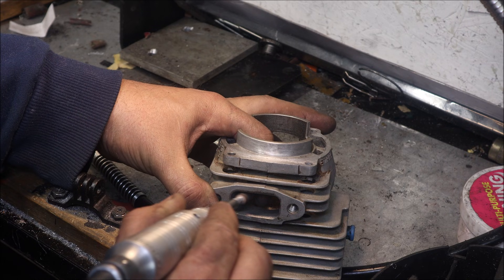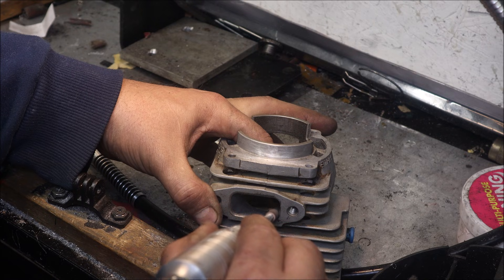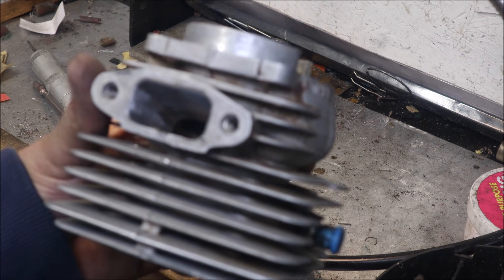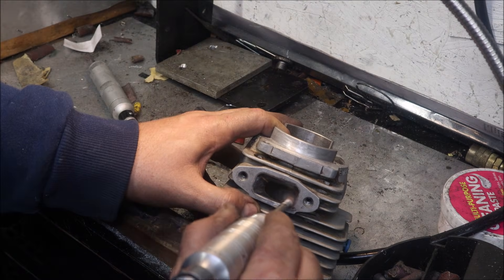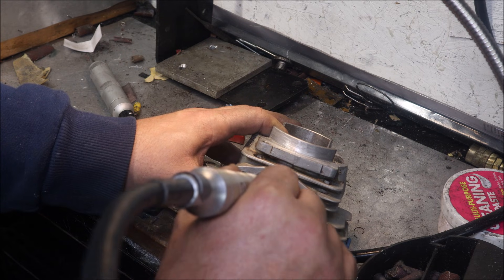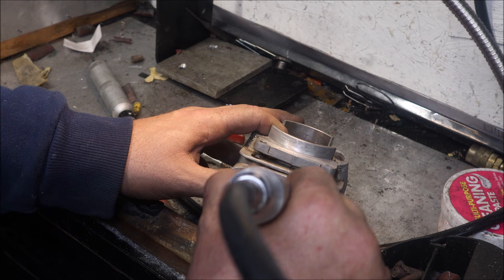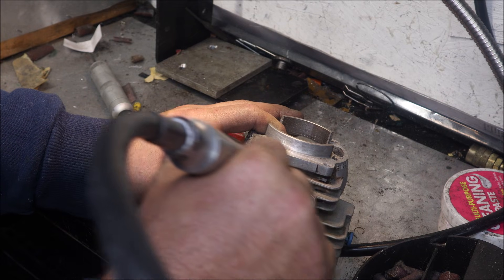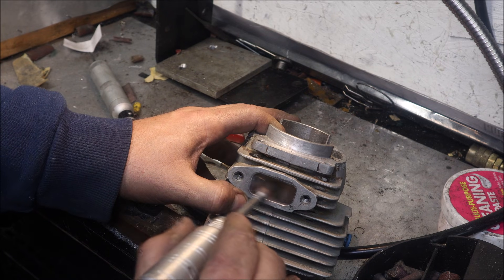I know there are a lot of guys that don't work up and polish the exhaust port. I keep showing here what the port looks like after each grit. Some guys just leave a mill finish — whatever they do with that carbide cutter they leave, and that is just fine. But I've gotten saws back in here from guys I build for, and after two or three years of use my exhaust ports still have a polish on them with very little to no carbon buildup. And these are logging saws, tree service saws, firewood saws — saws that have had heavy use. I do polish the exhaust ports. I think it's worth maybe one percent airflow gain.